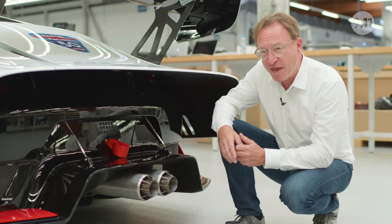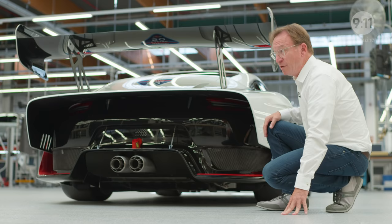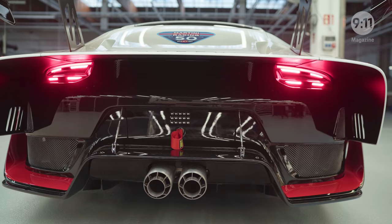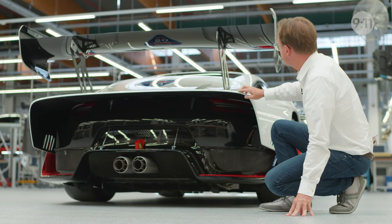It's titanium, but it's all hand-welded, which gives it a really nice, authentic handmade impression. One feature we really like is how the diffuser grows out of the sides — a very functional element housing the exhaust pipes. Underneath the shrouding you can see the original 911, and from the LMP project we integrated the tail lamps up in the wings.